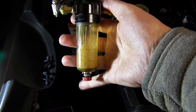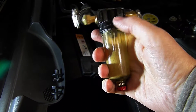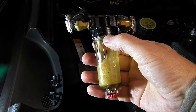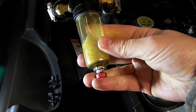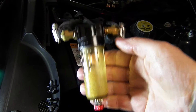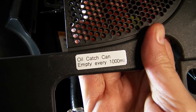This is a close-up look at the right-hand side catch can, and it does collect a fair amount of liquid. Unfortunately, the clear plastic reservoir is now somewhat seized to the aluminum threaded housing, so I need to drain it by pulling out the inspection plug on the bottom — that's how I drain this. It's about every thousand miles, and I also left myself a note on the cover to keep tabs on it.